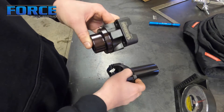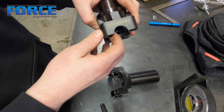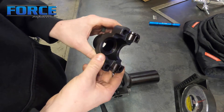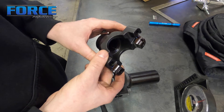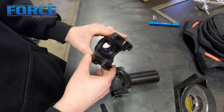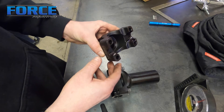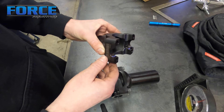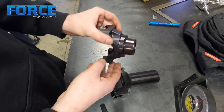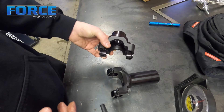We also need to install the rear yoke, part number U1596, which converts the flange on the S197 rear end. Push the front yoke in, pull it out an inch, then set the car to ride height. Once at ride height I'll check and possibly adjust pinion angle. After that we'll be able to measure drive shaft length and send those dimensions off to have the drive shaft built.